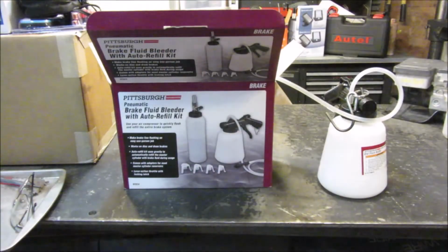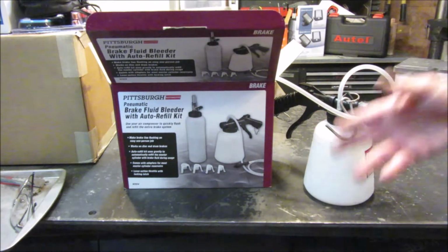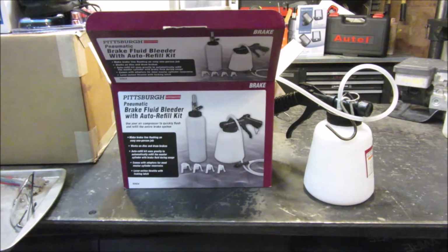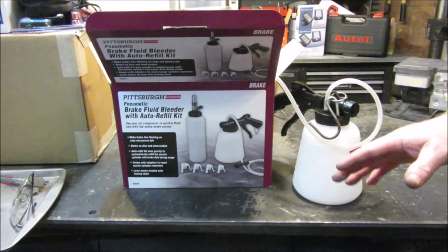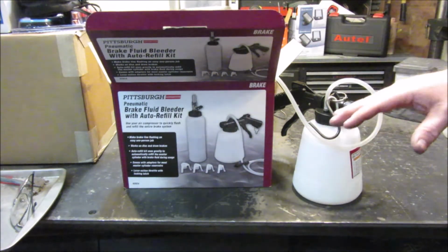Well, YouTube, I'm going to go ahead and just throw this in here right now. I tried this out doing the brake bleeding on my van, and quite honestly wound up bleeding it the old-fashioned way, with somebody behind the wheel pumping the brakes while you bleed it. I did notice that I started with this, but as I've seen in other videos, there were air bubbles. It never became solid fluid ever.